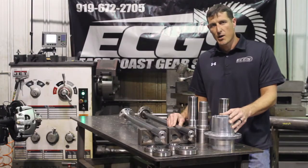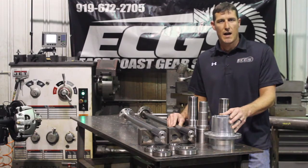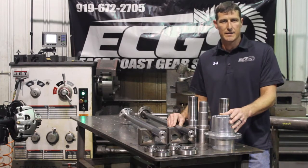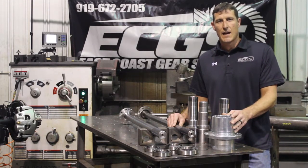What we've seen in the marketplace thus far doesn't exactly cover all the bases. So that was what we were trying to do — how do we create a spindle and wheel hub with brake kits that works for many different applications? The first thing we did was come up with a spindle design that was big enough to fit the 40 spline shaft.